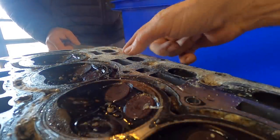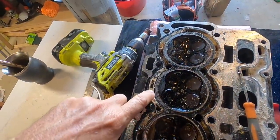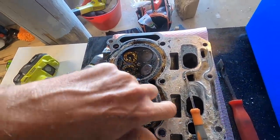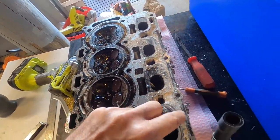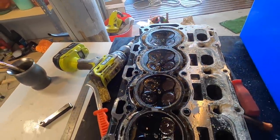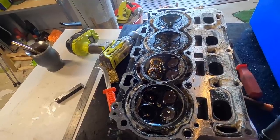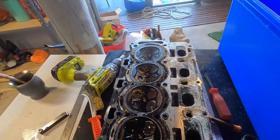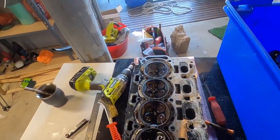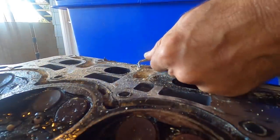It's pretty gentle, which is good — I'd rather be gentle than do damage to it. A lot of gunk in the water jackets here. This passage here is completely blocked, which obviously cools the exhaust. I'm thinking maybe this is a head gasket problem due to overheating — possibly an alarm failure too, rather than corrosion. Apparently a few of these just have the block corrode and it's pretty much hard to fix. But this looks like it may be recoverable. Just frustrating about the rust that's already on the cams and the bores because of the emulsified oil — makes what could have been a relatively simple fix into a much bigger job. It's quite hard, salty corrosion.